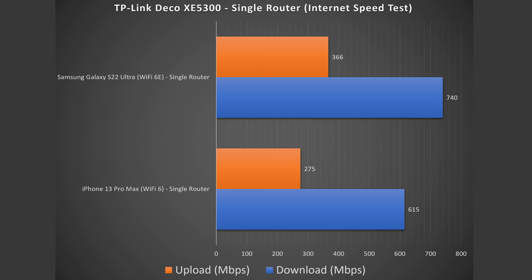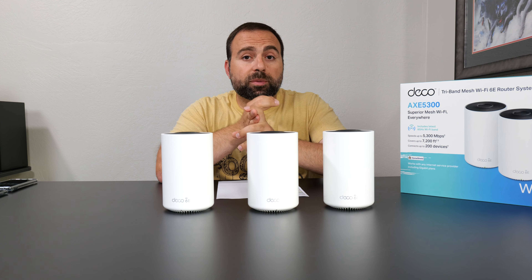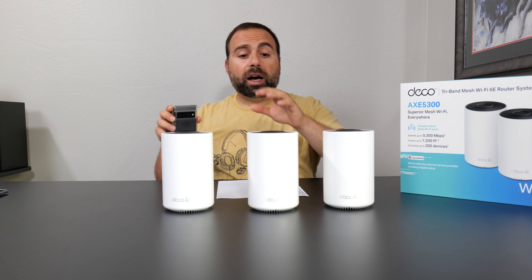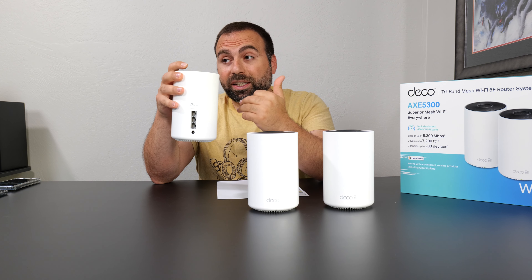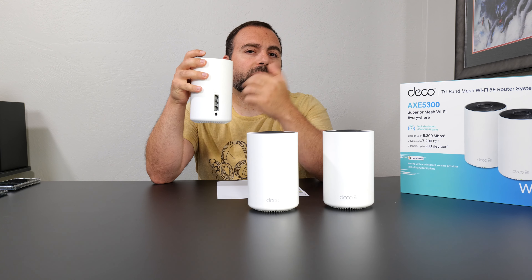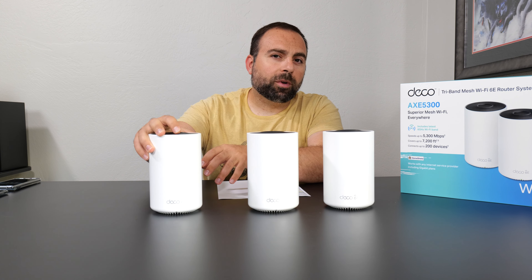To truly find out the capabilities of this mesh system, we remove my ISP and the public speed test server from the equation by making my computer into a local speed test server — going from phone to router to computer and isolating the router. This gives amazing results: we get pretty much close to gigabit speeds for both the Wi-Fi 6 and Wi-Fi 6E devices. The ports on this thing are limited to gigabit, so Wi-Fi 6E can actually go faster than this. If one of these were a 2.5 gigabit port, I'm estimating I'd probably get around 1,400–1,500 Mbps down and around the same for upload.